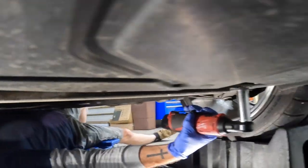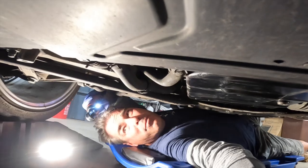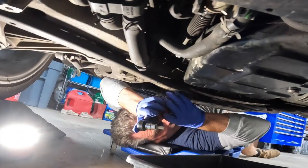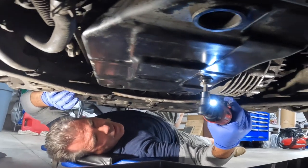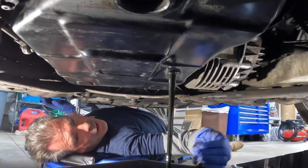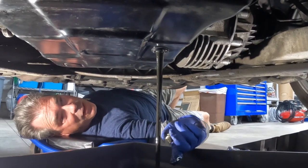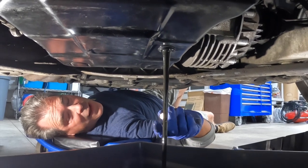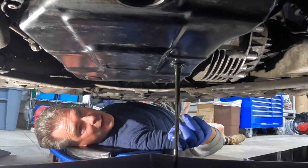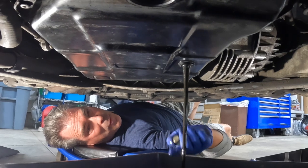I've already pre-broke everything. I've also pre-broke this big one so let's get it off. I prefer not to get my tool all schnanky. That's pretty dark fluid. Let's go ahead and let this drain. One of the things they say is you should do this while the engine and transmission fluid is cool — that way it all drains into the pan. When the transmission's hot, it's going to be up in the gears. This way you can get the maximum out. Let's go ahead and let this drain and then we'll come back when we're ready to take the pan off.